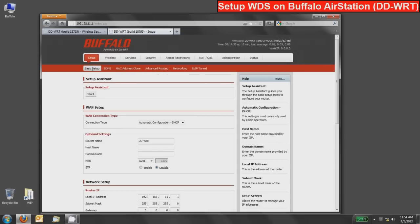Click the basic setup area — this is where the configuration gets a little more advanced. Technically you do not want two routers on your network, and you also can't have two devices with the same IP address of 192.168.11.1. So when we set up this second device as a slave, we need to adjust its settings so they don't conflict. Since this is not the router and it's not connected to the internet, we need to give it an IP address that allows it to connect to the router to gain internet connectivity.